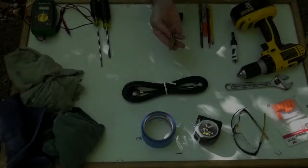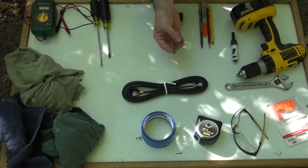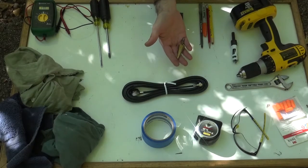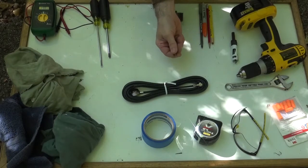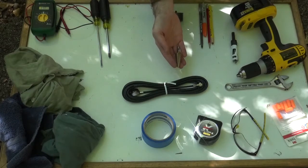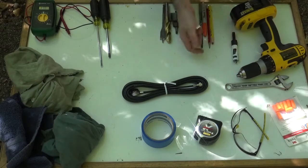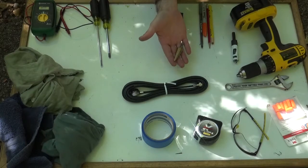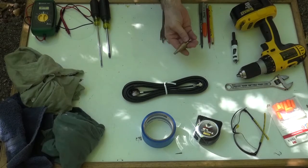Another option is the unibit, a 3/4 inch unibit, although it's not the highest recommended bit for the job, for a few reasons. It's pretty expensive, $20 to $40, and they dull fairly quickly, and they're not really anything that you can sharpen yourself. So if you're going to be the person doing the installs for your group, you definitely want to go with the commercial grade hole saw. And this particular bit, if you happen to have one laying around, it certainly could be used, but for a lot of jobs I wouldn't use this.